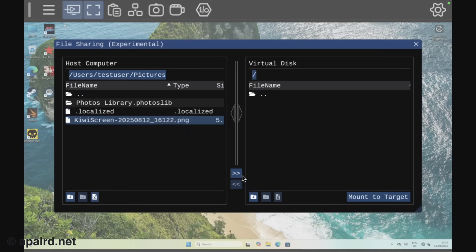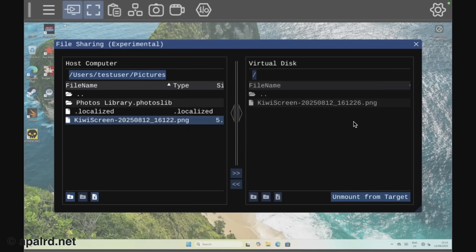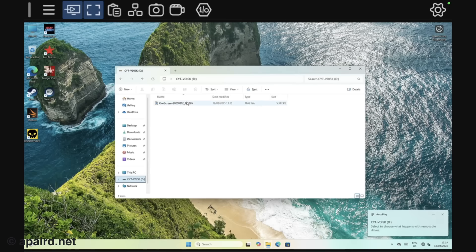Let's see if I can send this to mount a target — let's see how this goes. Oh yeah, I got a virtual disk. Now, last step: can I use this to reinstall an operating system? That means can I get into the BIOS, can I mash the delete key, can I deal with any weird resolutions the BIOS is doing, and can I get into imaging like a Linux installer? This thing has that cool file mounting feature — it'd be neat if they could also mount ISOs. But I've got a flash drive with Linux on it, and I'm going to plug this into the system and try to boot it.